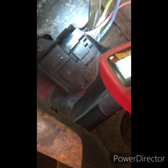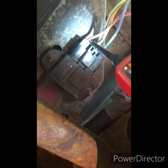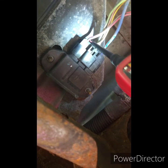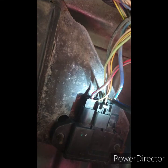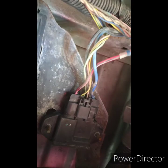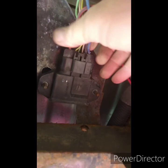Back under the truck. Got the power probe plugged in — this might be a little difficult to do one-handed. I'm going to hit this power wire, I've got the key on. It looks awful green right there. Just check the ground — high ground. I might unplug this and just see if it's got power. Yeah, this is hard doing this with one hand — and then it's got power. What the hell is going on here? Not ground. What the hell — that's weird.